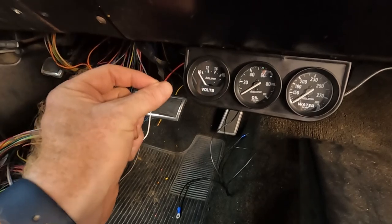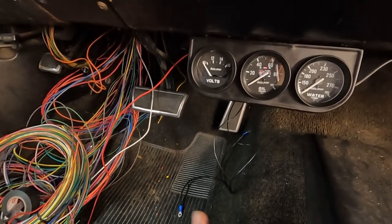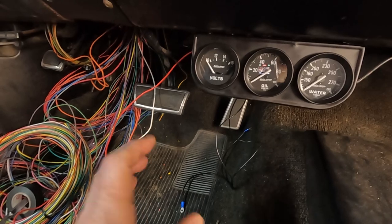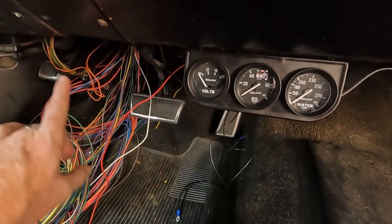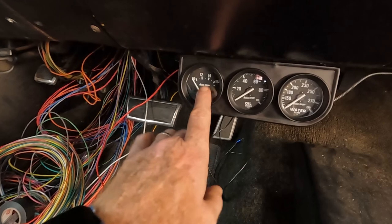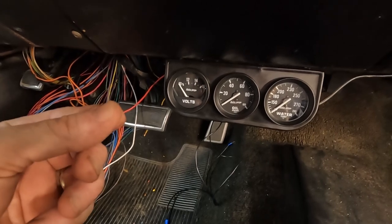There's a bolt that's going through there. Like I said, you could drill a hole and put a bolt through there and then put it through the two holes. But that's how you want to ground it. Just make sure you don't have any rust. Make sure there's no paint there, and you should have a really good ground. If for some reason, when you get everything put together, you get everything connected and you're seeing that it's not working, you don't have lights and you don't have a good voltmeter reading, then there's a good chance that maybe the ground isn't on there tight enough or that it's up against paint.